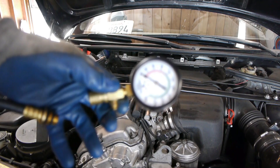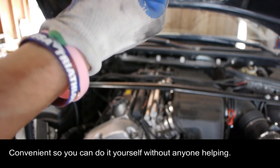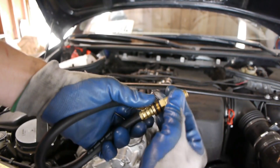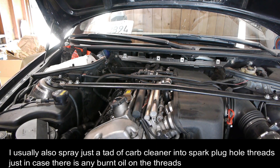For the compression tester I use this IEC compression tester that goes up to 300 psi. It comes with different attachments and does hold maximum pressure. You can just release it here — you just have to make sure you get the right thread size. It comes with a lot of attachments; this is the thread size for the spark plug. Tighten it up by hand just to seal it, compressing that ring, and then thread this end into the spark plug hole.